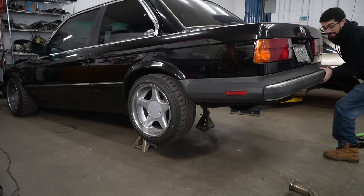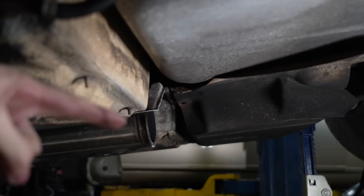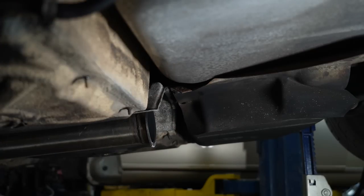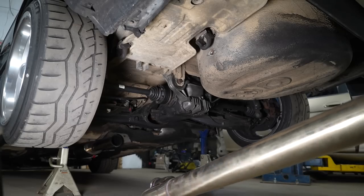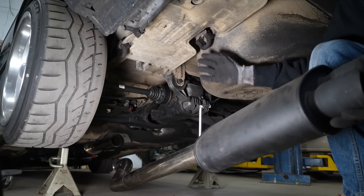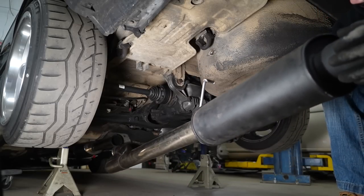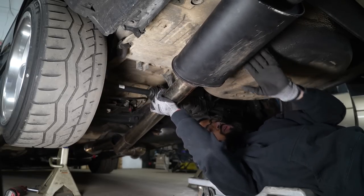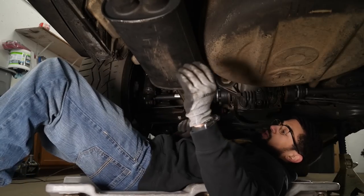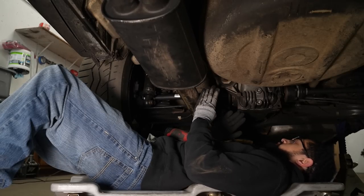Always give it a shake test before you go under. It's pretty good. As you can see my exhaust is dumping right here and this is the gas tank, so all the flames are just right in that area - not good. I also want to add more than just this one hanger. I only have one holding up this whole muffler back section and it's just banging into my wheel well, which isn't the best. There we go, the exhaust is back on. I can decide where I want to cut it - I think I'm gonna cut it right here after the diff axles.